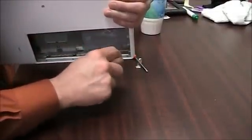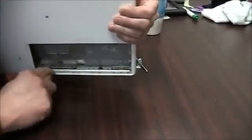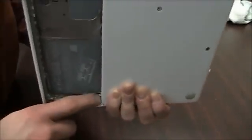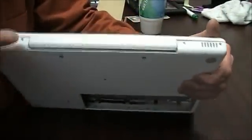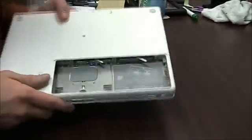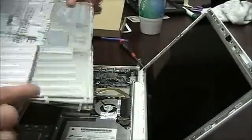I've started off by removing screws — the second, third, sixth, and eighth screw here, then these two screws right here, these two screws right here, these four screws on the back, and then there are some tiny screws on the inside here, here, and here. After all that's done you can undo these three on the back of the MacBook, and then you'll be able to pop the lid and pull the keyboard.